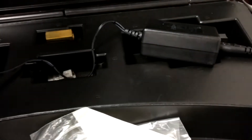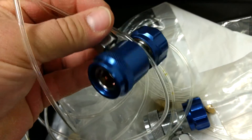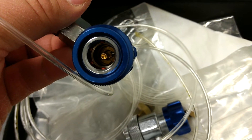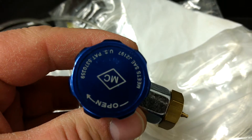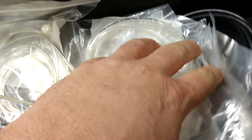Here are the parts that come with it. You've got a charger, a tank adapter, and a hose adapter, along with a couple other little parts. You have the YF adapter — J639 for R1234YF — which you would connect to the low side service port on the vehicle and then connect the other end to the back of the machine. It also comes with an adapter for R134A, your standard R134A adapter, a whole bunch of other little adapters, and a USB cable if you needed to connect this to a recovery machine.